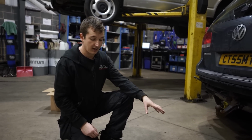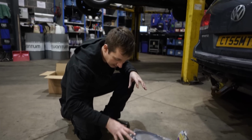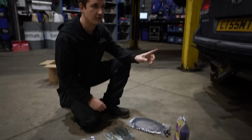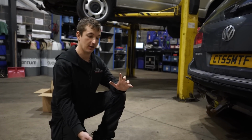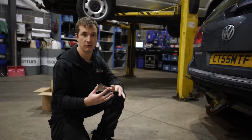So there's that. And obviously, this is only giving us an inch on the top of the struts and then an inch on the bottom, which is lifting the strut only an inch, which on these is not a problem, but on the air ride equipped cars, you're already able to pretty much max the CVs out on the drive shafts, so we need to do a diff drop if we go any further,